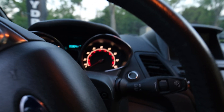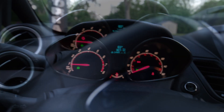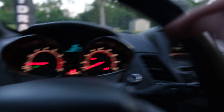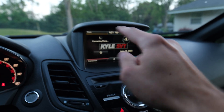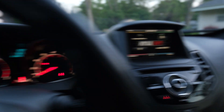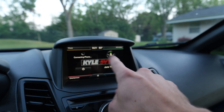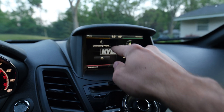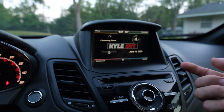Now we'll go ahead and start the car. One thing I forgot to mention is that you want to make sure your car is telling you that there's a tire pressure fault — that might take a little while to drive. You're going to have to drive until that light comes on, and then in the MyFord touch screen area it will tell you there's a tire fault, then you can go into pairing mode.